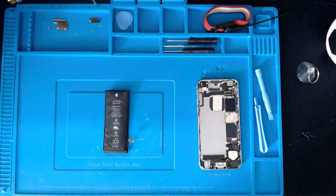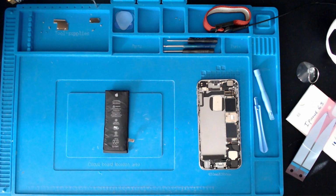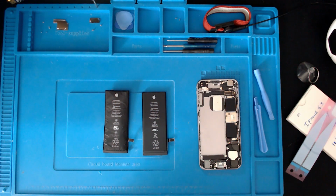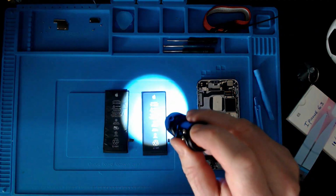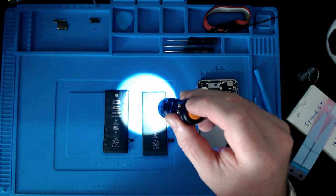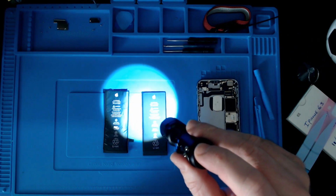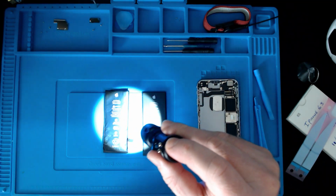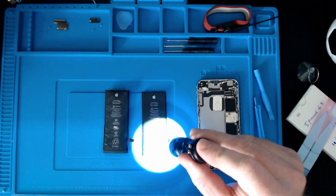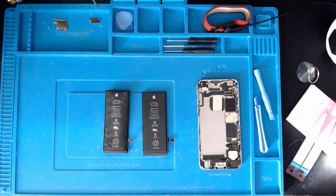Now I'm going to take a look at the replacement and see what the part numbers are saying. Hopefully, I bought this as a genuine replacement, so fingers crossed it is like for like. So they're both 3.82 volts, 6.55 WHR, and they've both got the same APN number, 616-00036. And everything else looks to be exactly the same. They're both 1715 mAh. So on the face of it, this one looks to be an exact genuine replacement, but I will link this battery in the description.